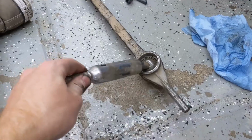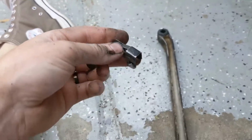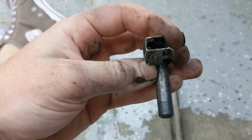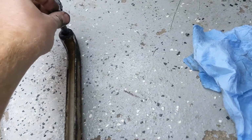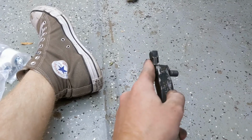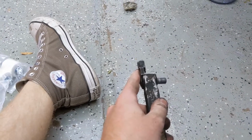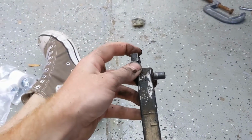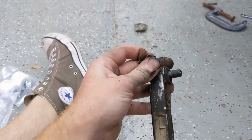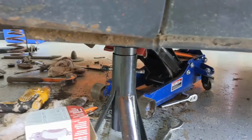Alright team, after fighting this unit for the last, I don't know, half an hour, you have to get this clamp off, and it's on top of the transmission. It has a pretty deep rivet in there, but basically it fits in here, sits like that. And what I did, rather than dropping the transmission and removing the drive shaft, is I went from the top side coming this way with a screwdriver, and basically pushed the screwdriver into this little slot, so much so that I pried it off. So I did it without removing too many parts. I didn't want to remove the drive shaft.